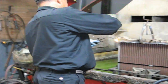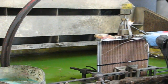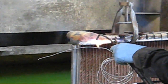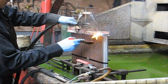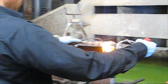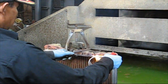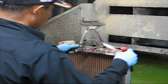You'll see here that he's using a torch to solder the tanks onto the core. He puts a little flux on there, heats it back up, and applies more solder with a little heat, soldering all the way around the whole side before flipping to do the other side.